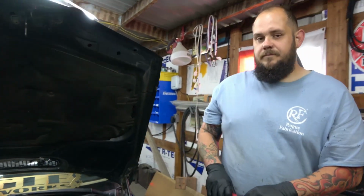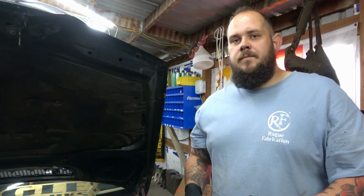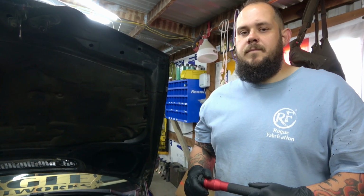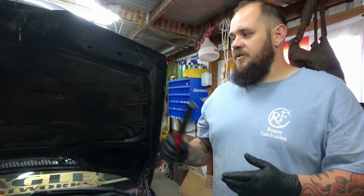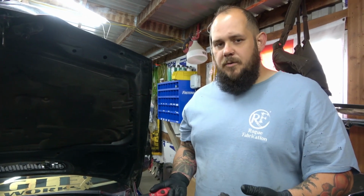Okay, can I ask you a question? Yeah. So adding this part is good to monitor the oil, but it's also a necessary component if you were going to turbocharge the car. Is that correct? It is definitely helpful. You can use that same distribution block to run your oil feed for your turbocharger as well. Nice.